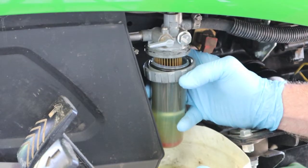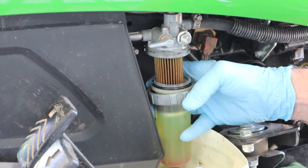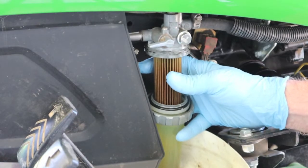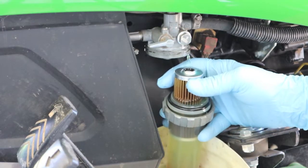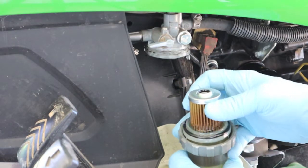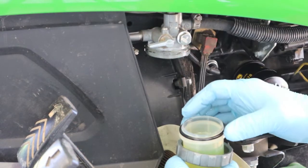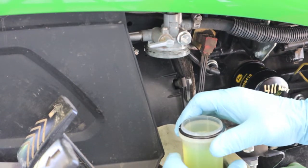I'm going to switch and inspect that O-ring on that flange nut. If it looks decent, I'll go ahead and use it — I just didn't want to get in a position where I need one and have to make a special trip to the dealer to get it. I'm going to leave some diesel fuel in this because we're going to put some water in there and see how much water it takes to float that WIF.